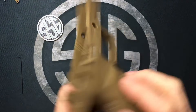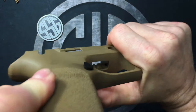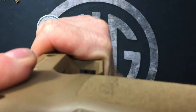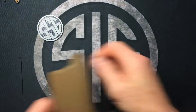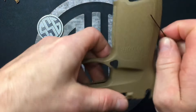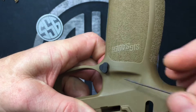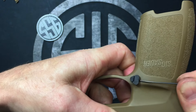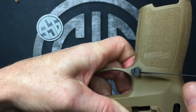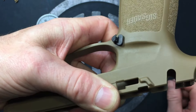To remove it, you can see it's flush here. What we need to do is press it so we can see the hole in the back side. What I usually do is hold it with my finger, insert my tool into the hole, and just push in, lift up — push in, lift up — over and over. And you can see that just walked right out.